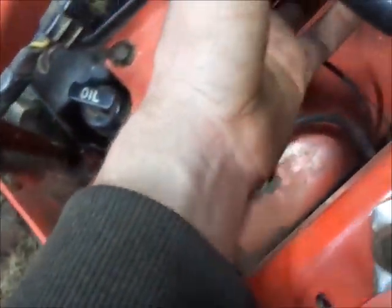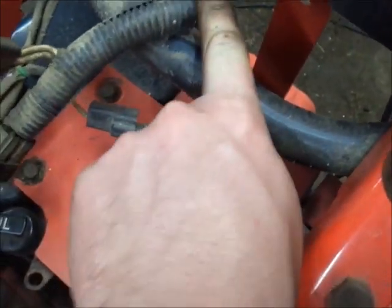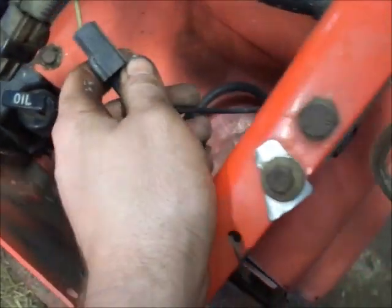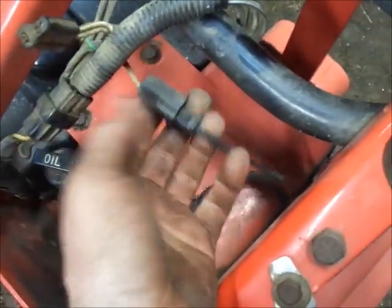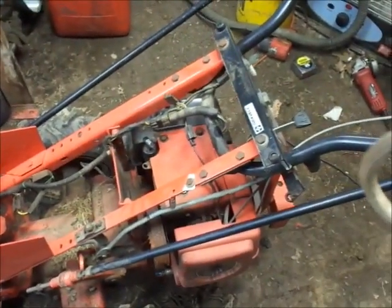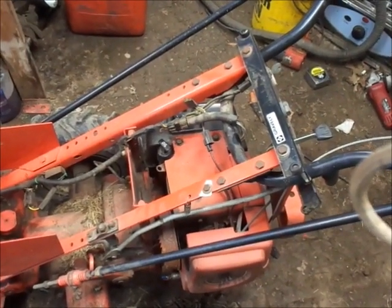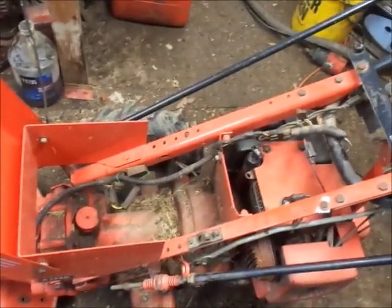There's the grounds. There's all the wiring for the handlebar safeties. There's a bunch that goes up there. And there's the kill wire. So basically if you have trouble with anything and you're out in the field, you just unhook this wire and you pull it over so it'll start and you drive it back to the shop and fix it. But that was a lot of people's fixes, was driving it back, unhooking that wire and never fixing it. So, you know, always something.